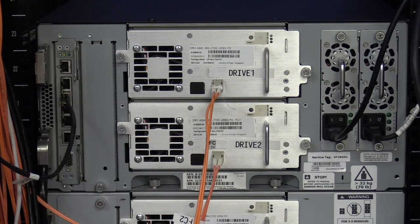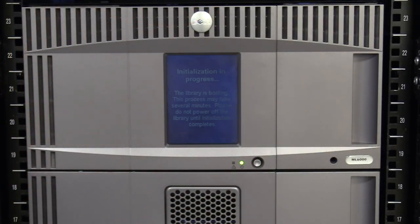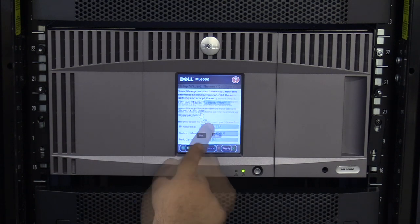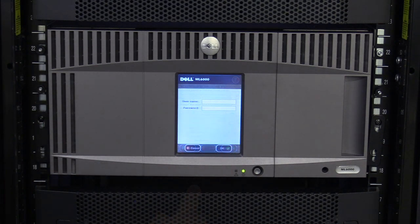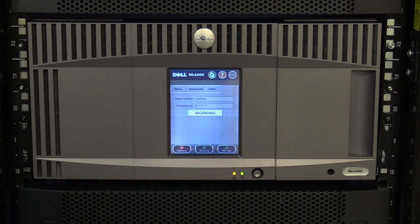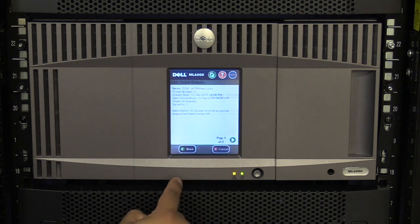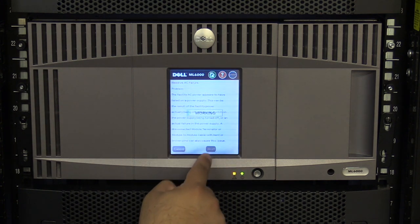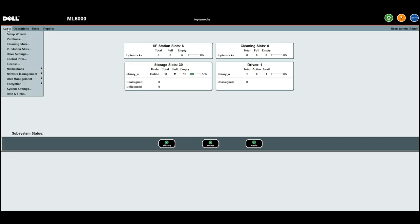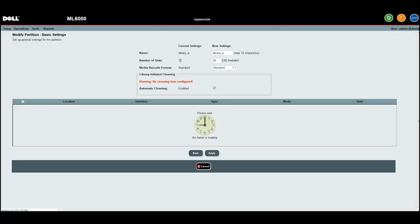Last, install all cables that you removed prior to working on the library. Flip all power supplies to the on position, then go around to the front of the library and press the power button and wait for the library to initialize. While the library is initializing, you will see the initial setup wizard. Please complete this wizard using the parameters the administrator took from the old control unit prior to removing it. Then make sure that the library comes up clean without any errors. If there is an amber light below the operator panel after the library initializes, log in as an administrator and examine if they are related to the work just performed and clear them. If you have any questions regarding examining and clearing RAS tickets, please see the link in the description below. If you are having any difficulties, please open a support ticket through the Rocket Plus customer portal. It will now be the responsibility of the administrator to set up the library settings from scratch using the information they saved from the web GUI prior to powering off the original defective control unit.